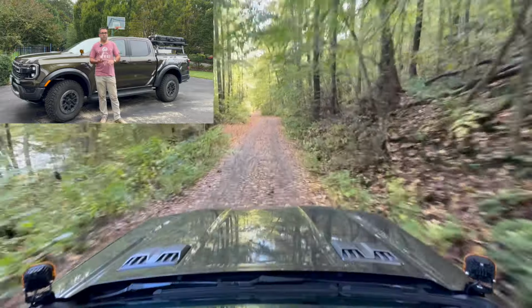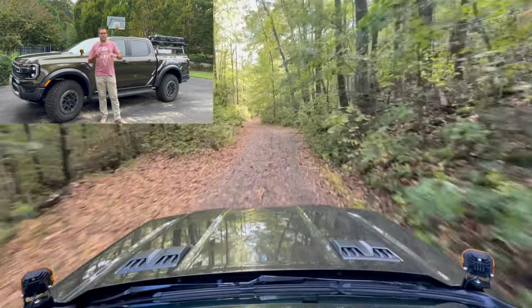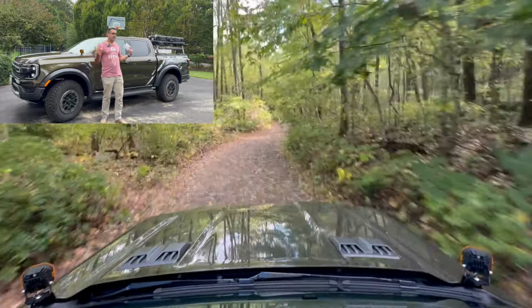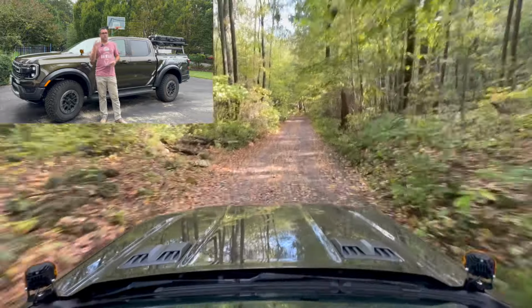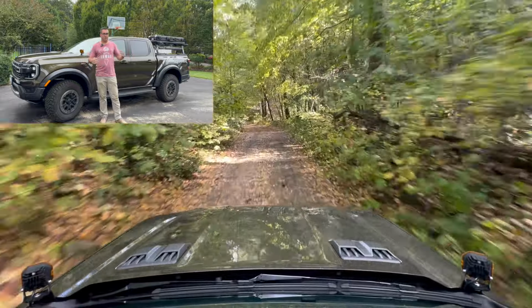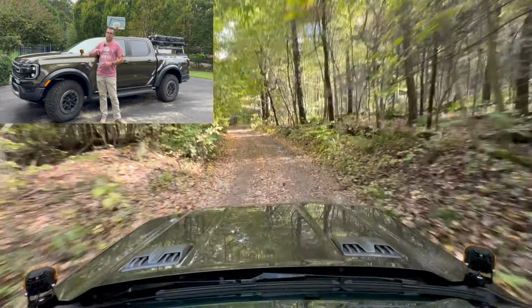So less humid air is more dense, which is kind of counterintuitive, because when you go outside and it's super humid, it's like it hits you in the face. But actually, water molecules are bigger than oxygen molecules, so it's less dense if it's humid air. And your engine likes just pure oxygen or pure atmospheric air, not a bunch of humidity in it.